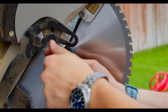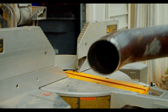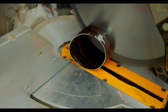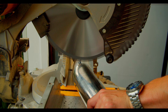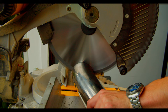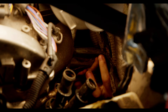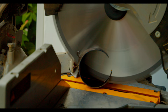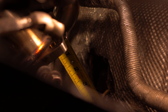I tossed the blade on and the first thing I did was square up the end of the 225 downpipe. Once that piece was chopped and the rain started pouring down, I moved inside the garage and chopped the end off the GTI downpipe. We don't need the bottom half of this since that's just going to clash with the driveshaft — we just want the top part. From here we started a very long process of alternating between hopping under the car, reattaching everything, and making adjustments to make it fit just a little bit better. The first thing you're looking for here is just general fitment. I ended up shrinking both pieces down quite a bit and took some general measurements for the length.